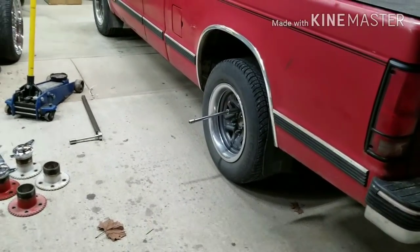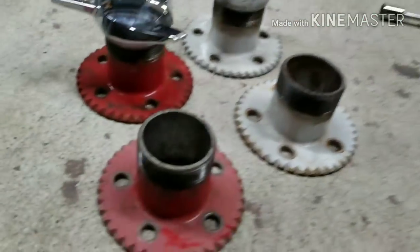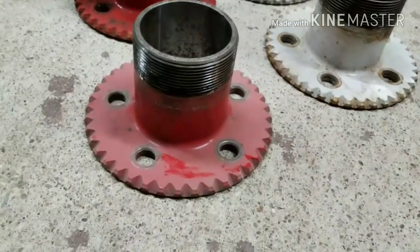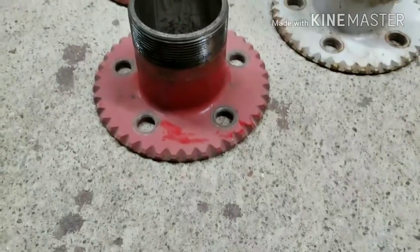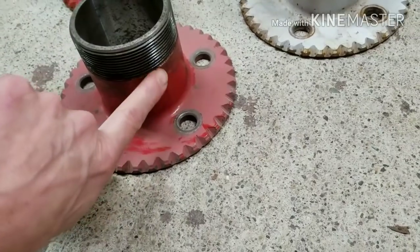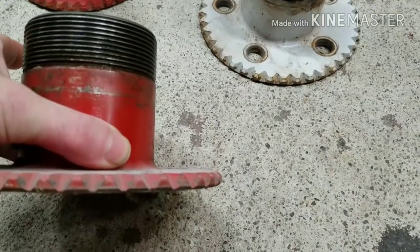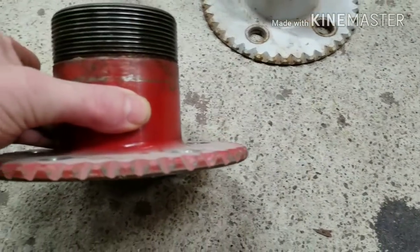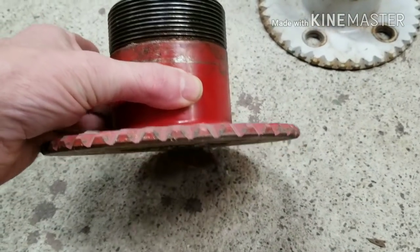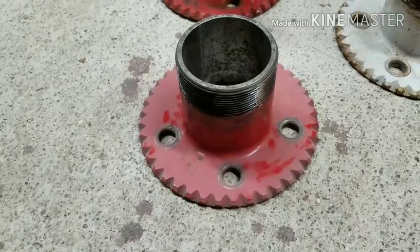All right, let's get some wheels on this thing. Seen in my other videos that we talked about these Dayton adapters. These are the old school style here. The original, and you can see it's all one size there, I guess you might want to say. There's no taper or wide section at the bottom, so these ones are going to be a little bit tougher to get on the rear over the drum, the center.